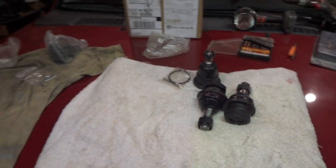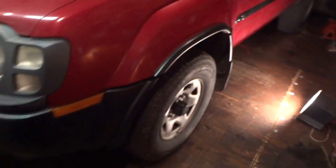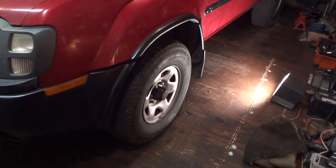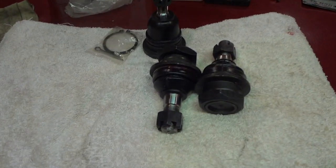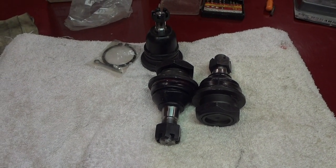What I've got to do is go ahead and get the wheel off. We're going to pull this apart and I'll show you step by step how to get everything out of the hub — the bearings, the lock keys, and all that. Then we'll start pressing the old ball joints out and pressing the new ones in, and you'll have a really nice steering vehicle with no more play and hopefully no more clunks and rattles.